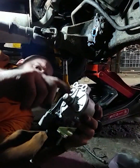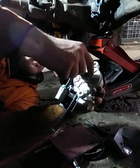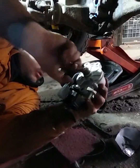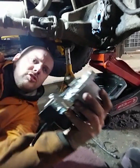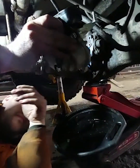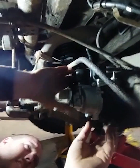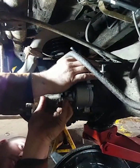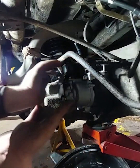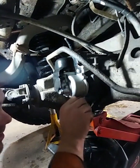And then there's another trick: put a little bit of the diff gear oil around, dip your finger in it and pull it round on the seal — just enough to help it in. Mount it up and give it a gentle shove. Because of the blanking plate it would have kept it in line. There you go — seated nicely. Get your bottom bolt on first.